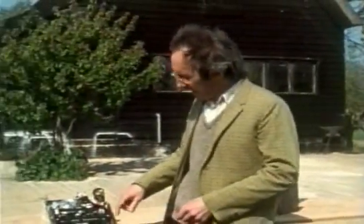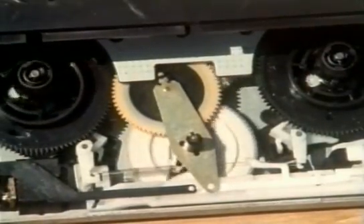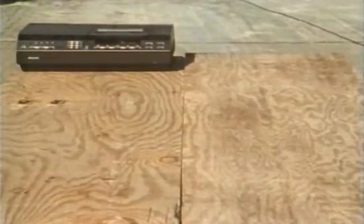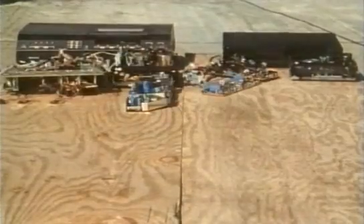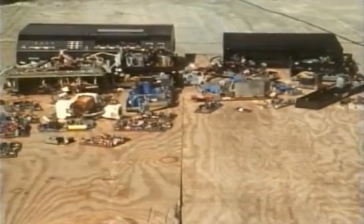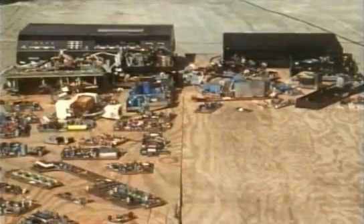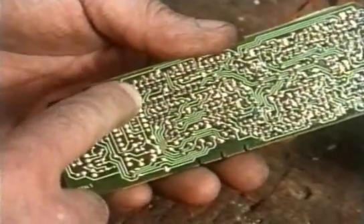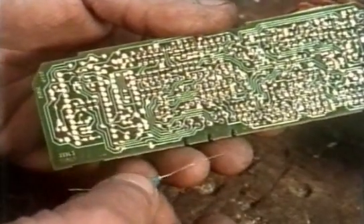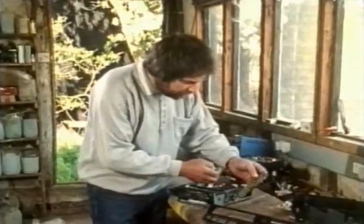Today, the rubber bands in video recorders have been replaced by gears and other mechanisms that are much more reliable. The old machines were twice the size and weight of the new ones. Without modern microprocessor chips, the old machines had three times as many components. This miniaturisation does have some drawbacks, though, when it comes to repairs. These little black dots on here are actually this component in miniature, and it's bad enough replacing one of these tiny things without trying to replace one of these little tiny modern resistors.